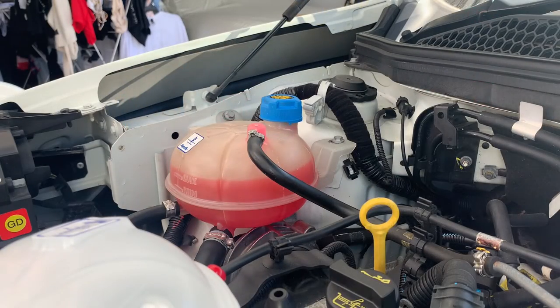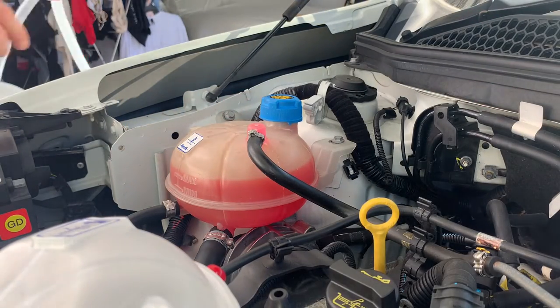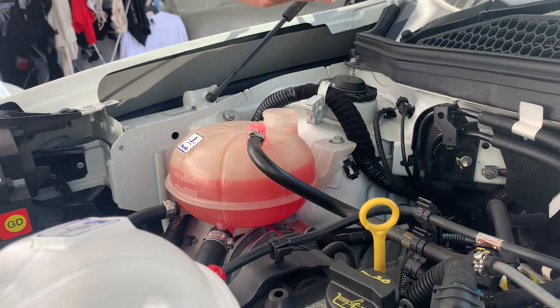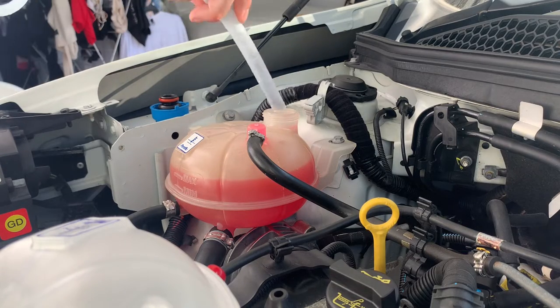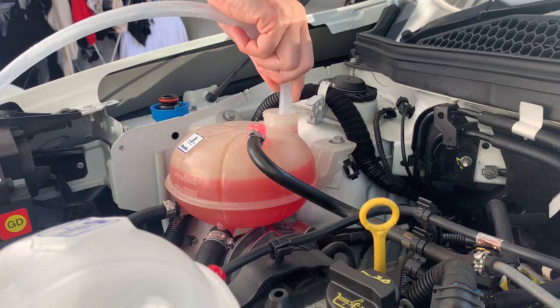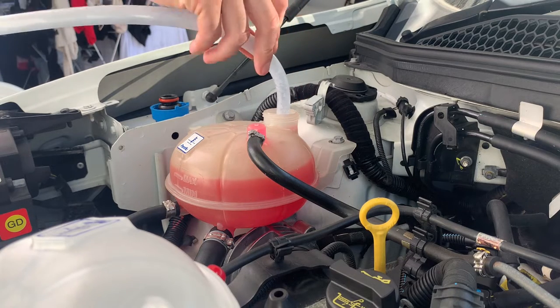So we'll start by removing the fluid. I've got a bit of plastic tubing here, it's actually from our fish tank. Now the new one comes with a new cap, which is cool, so we don't need that anymore, but we'll put it aside and we'll just put in the hose and do what you want to do to start the siphon. This is poisonous, so don't swallow it.